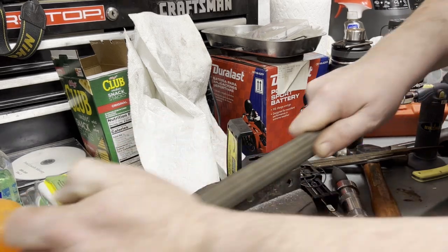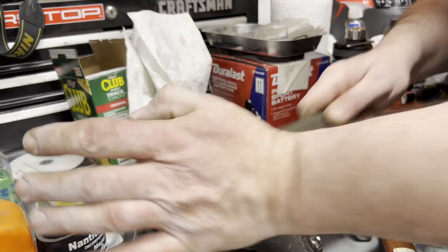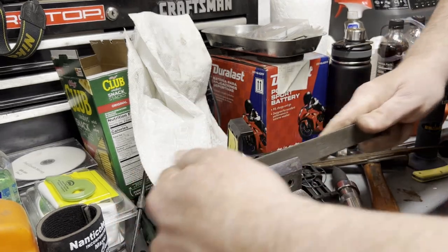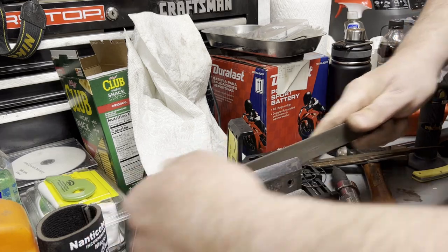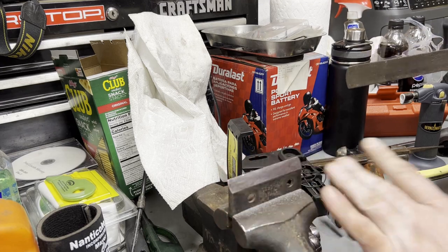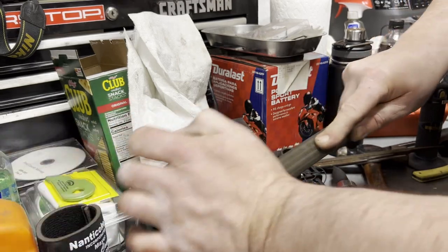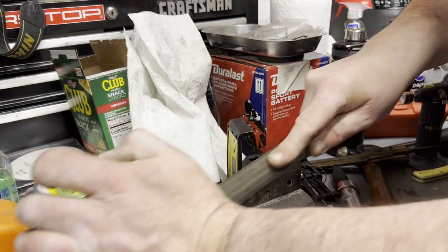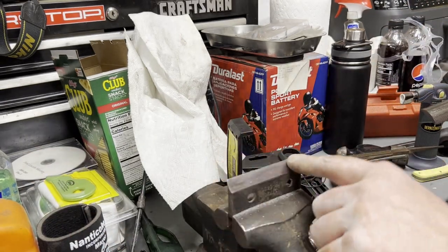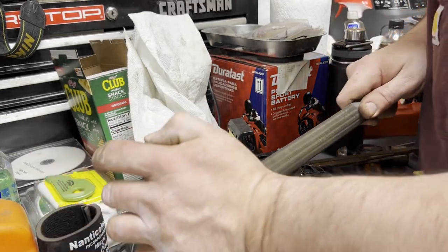That round stone, the wheel, definitely fixed it up, but as far as getting a nice even finish across here, which is what I think you want, there's only one way to do it, and that's with this file. Now it's got a nice straight edge on it, and it's pretty sharp. It's nice and smooth. I'm going to work it down until it's all nice and even. I don't have any low spots, but it looks like it'll do the job now.